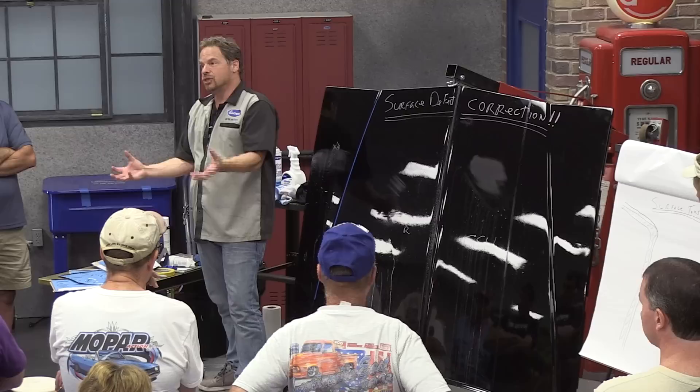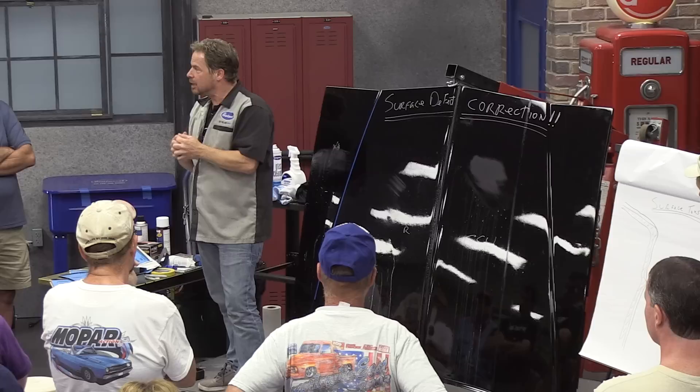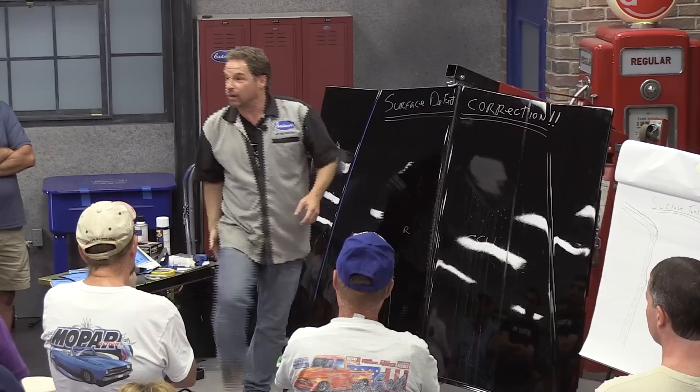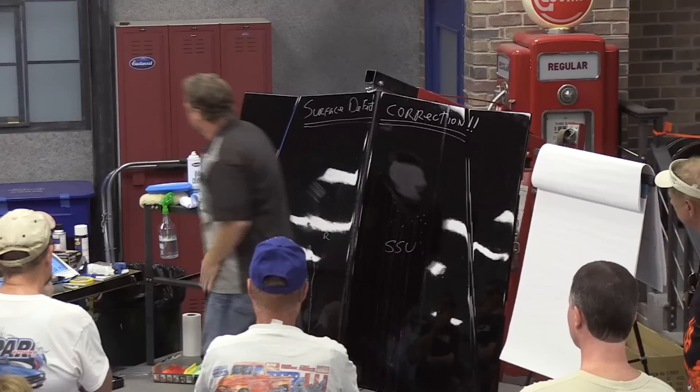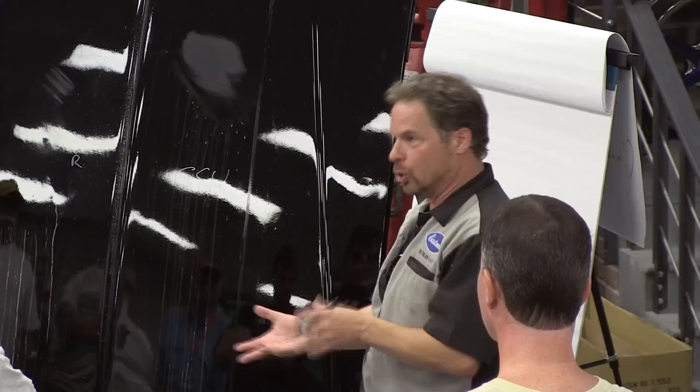Then I go 25% color, 75% clear as my fourth coat, then 100% clear over all of it. It's got to be a compatible clear and you can't intermix then catalyze — you mix your batch, then you intermix. What that does relates to the difference between reflection and refraction. Does anybody know? Refraction is how much light passes through — that's precisely it. That's why a clear coat system is more brilliant. That's why a candy makes us feel something when we look into it. A candy is a gold or silver base coat — a true candy — with a translucent mid-coat, whether blue, silver, aqua, then a clear coat over top.